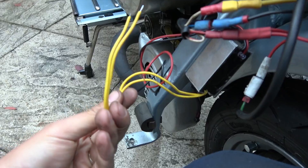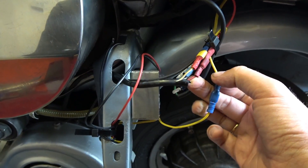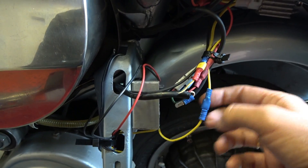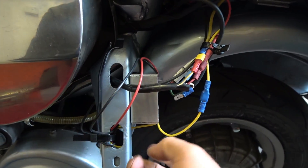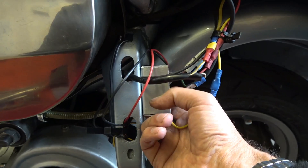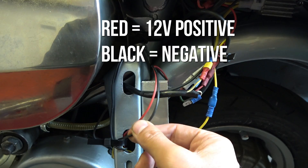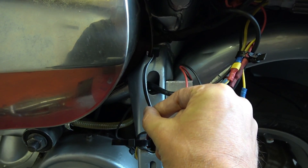The clever thing about his IntelliConverter is it will put out 12 volts when there's less than 12 volts AC coming in. I've got this yellow wire plumbed into the main output wire from the stator plate, which goes to the regulator. On this one it's the yellow and white wire on this Veritronic. It powers the yellow wire going in and also goes up to the regulator and to the loom. Then the other yellow wire from the bottom input of the IntelliConverter goes to earth on the back — a bolt that holds it onto the strut.